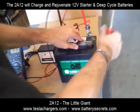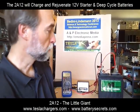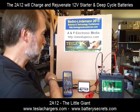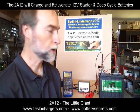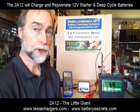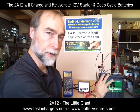This charger is capable of bringing this battery to the top of its chemistry without producing almost any hydrogen and oxygen gases at all. And it also remains at room temperature. What that tells me is that all the energy I'm taking out of the wall — that I'm paying for — is getting into the chemistry. None of it's being lost in heat production, none of it's being lost in hydrogen production. So this is a good demonstration of what we call a topping charger, and this is exactly the kind of equipment you need if you want to make your battery last for a very, very long time.